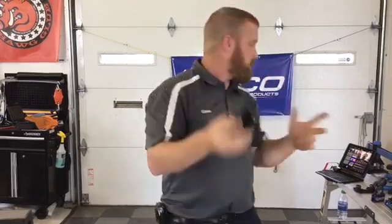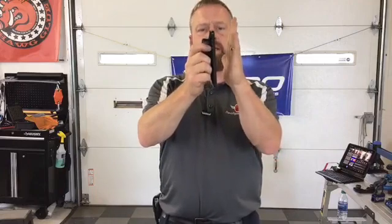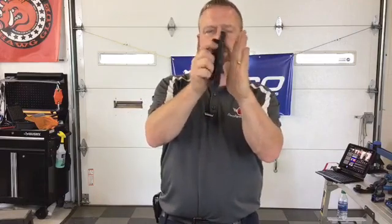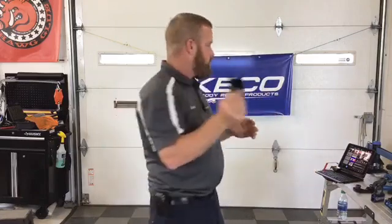3M Super 77, I was drawing a blank on it. Contact adhesive, where you spray both sides, would put that right back on. So I think what is happening when that fails is instead of this being planted flat, they're ending up on an angle, right, on different parts of the car. And Bubba, I'm not picking on you. The flat one. Yeah, so that's what we're talking about. What I see happening is techs are not getting this flat on the car, and it's on an edge, or it's somewhere where it's just working at an angle. And again, that K-beam will pull 1,500 pounds. So we're not ever getting that far, but hundreds and hundreds of pounds of pressure is actually pushing this, like the rubber's grabbing onto the panel, it's pushing across. That's what you're fighting. But yeah, that Super 77 contact adhesive should take care of that for you. No sweat.